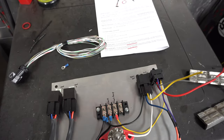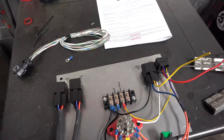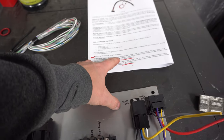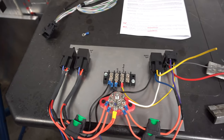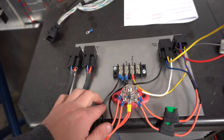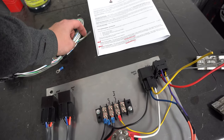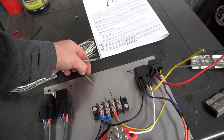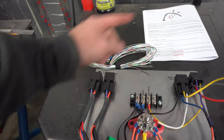Here is my little relay panel that I built — fuses installed. This is the time to pay attention, read and double-check everything. I actually had some stuff hooked up wrong, read it again, verified it, and now I'm hooking it all up correctly. Looking at the electric fans in the Holley documentation: it says the output will provide ground to trigger the relay. So on the trigger side of the relay you need to feed it with 12-volt power, and then it goes to ground through the ECU — not chassis ground like I was originally thinking. So the gray-yellow wire is one of the fan outputs.